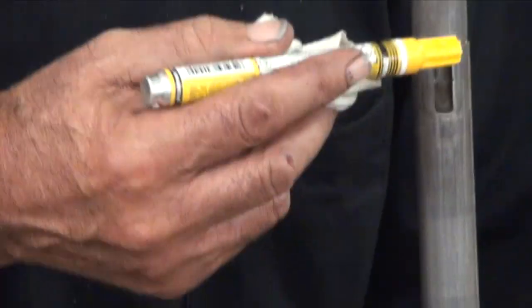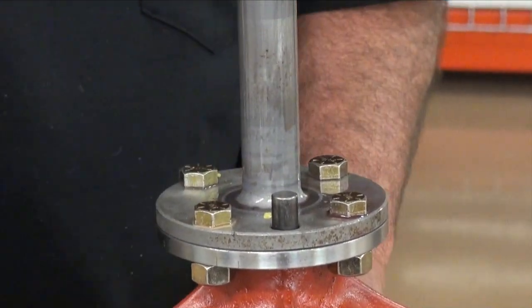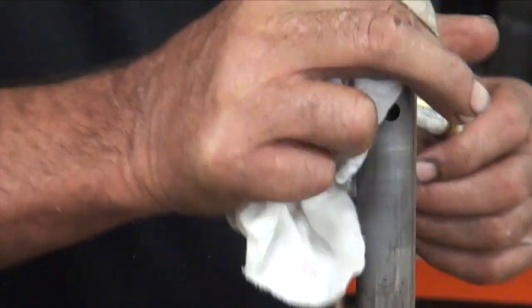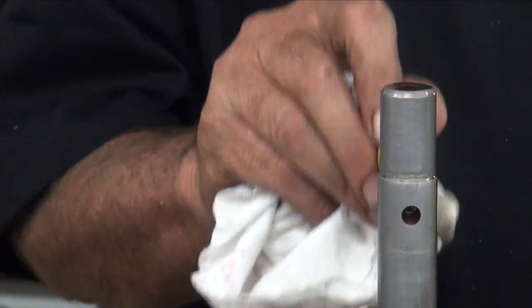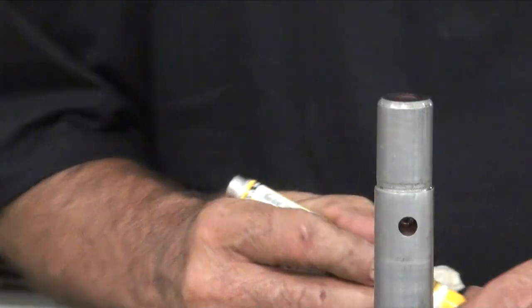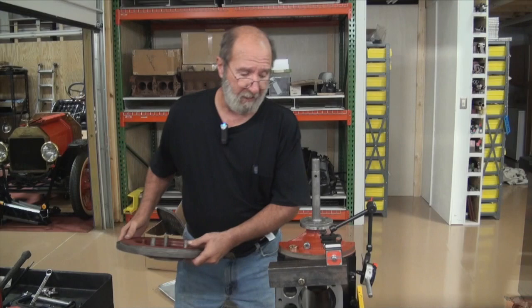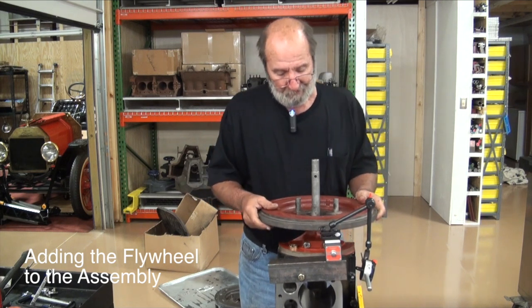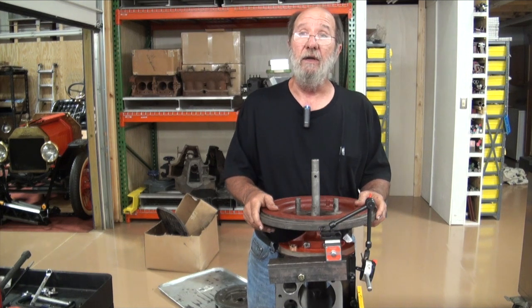The other thing I want to make sure is I got the main shaft orientation right — the main shaft can go on two different directions. I know that the keyway in this case happens to be in line with the rod throw. The rod throw is down and the end of the key is pointing in that direction. And just because I'm old and I will forget — sometimes the other direction works out better. So I'm going to index my keyway and I put an index mark on my crank with a yellow paint stick. So now I'm ready to tear this apart. And a lot of times when you put the flywheel on, things change — burrs on the pins, maybe the pins are worn out — sometimes you just have to go through a lot of trial and error.